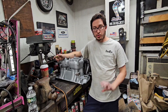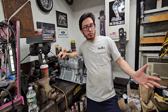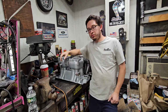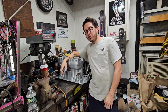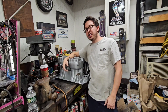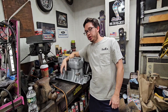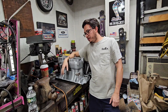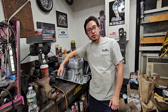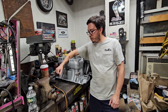I'll be able to do it pretty much on the fly, especially the way I want to set this up with the water pump and stuff. Might try to make one of those remote and put it off to the side, so that I can just go right in, advance it 4 degrees, 2 degrees, retard it, and see what it does to get the most power I can to make it run. So it's going to be something to play around with. And an investment like that, for accessibility, something easy, makes the car a little bit easier to work on.